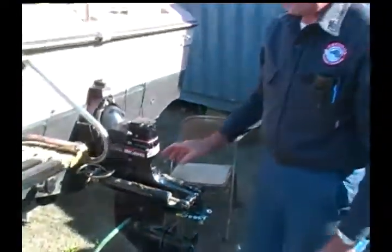And it's important to make sure that you do not start the engine without having water hooked up. If you start the engine with no water hooked up and running, within probably 10 to 15 seconds, the rubber impeller inside the water pump probably would turn to a mushy-like substance, which is a real problem. Then obviously it doesn't pump water, and then the engine overheats, and you have to pull the outdrive off, and you have to replace the water pump.